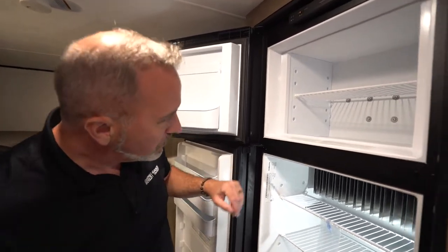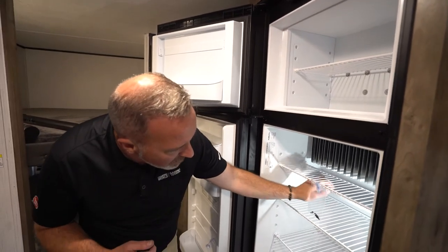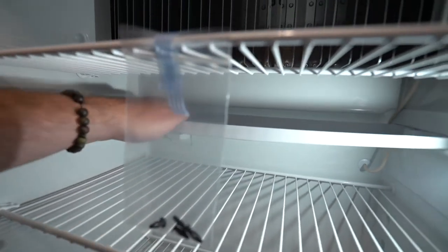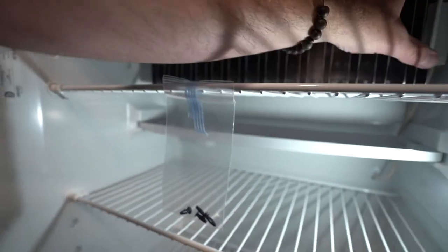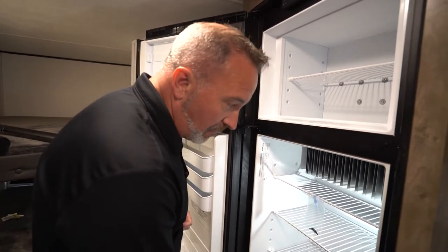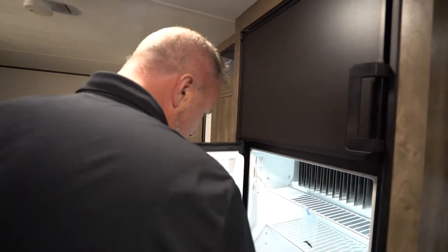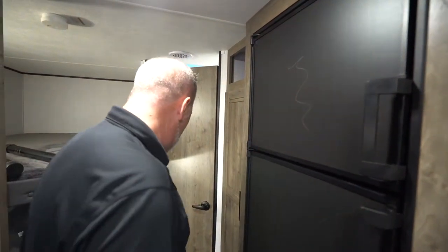For your freezer, you'll notice the space right there, and right here underneath my blades is a drip pan. This drip pan leads to a little tube on the back, so when this defrosts and leaks down, it actually goes out the back of the fridge. Sometimes if you keep this too cold, that pan can freeze and you'll start getting water in the RV floor. If that's the case, just come in and clean out the pan or warm it up so that the pan defrosts. What's cool about these fridges is they have the chalkboard front — so you can have some fun with that as well.